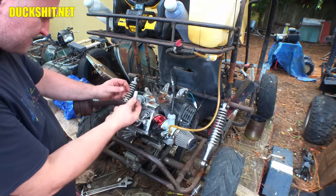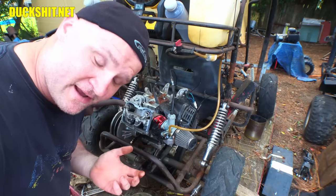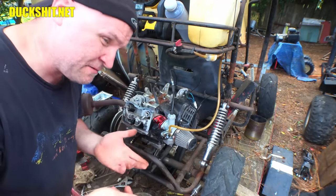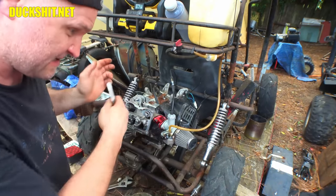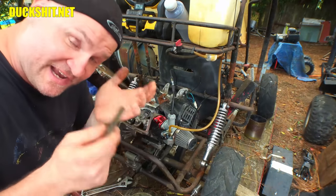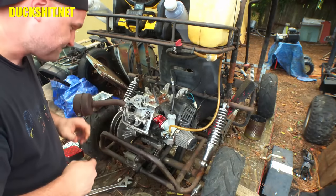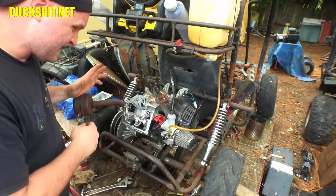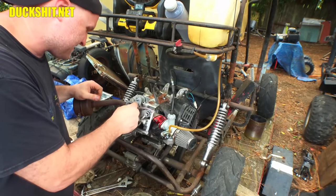Anyways, I got the feeler gauge out. I had to look up the specs on this. When I looked it up on the internet, people would say, well, I use 2 thousandths, or 8 thousandths, or 6 thousandths, or I use this for this and that for that. What are the actual numbers that the manual says? Anyway, the answer is between 4 thousandths and 8 thousandths. I like a quieter valve train. I don't mind checking it periodically, so I'm going to go with the 4 thousandths.